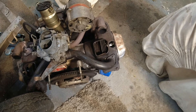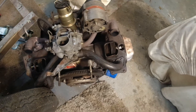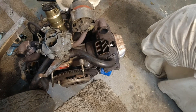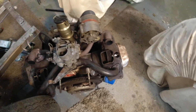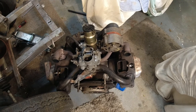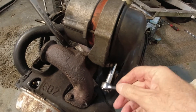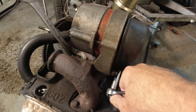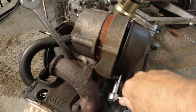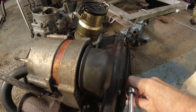We've got basically four bolts, four nuts, all 11 millimetre, and then it'll lift off with the carb. I'll drop the alternator off first. The alternator covers a couple - three 8 millimetre bolts. It isn't even tight.